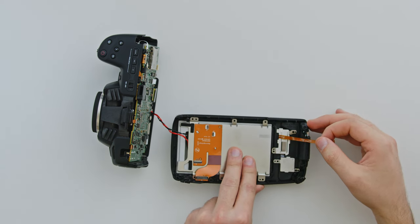If the borders on the left and right are way out, you're probably holding the display enclosure upside down. Make sure the screen is firmly attached — the adhesive will take hours to cure properly, but we can continue the assembly. In the mod kit, find the small plastic bag with the four hinge tension inserts — there are two thick and two thin. For this step, take the two thick ones and insert them into these gaps, with the rounded side facing up and the rounded corner fitting into the edges. Push them all the way down with the flat edge of the plastic spudger, and make sure they're pushed all the way into the edges so there's an empty gap in the center.